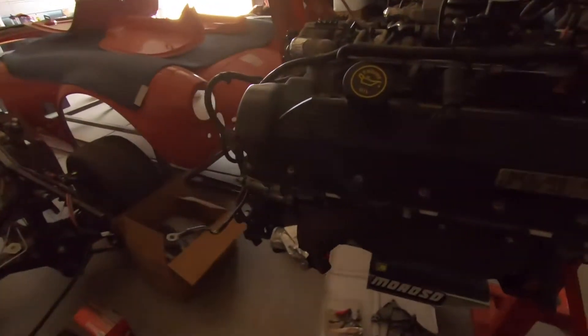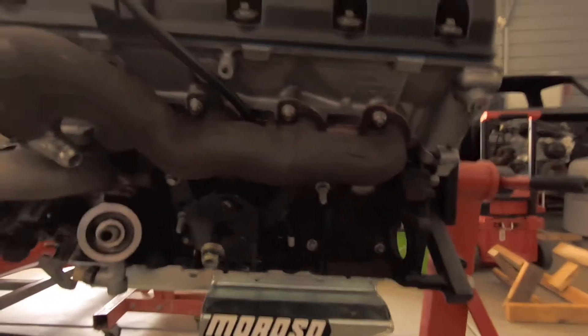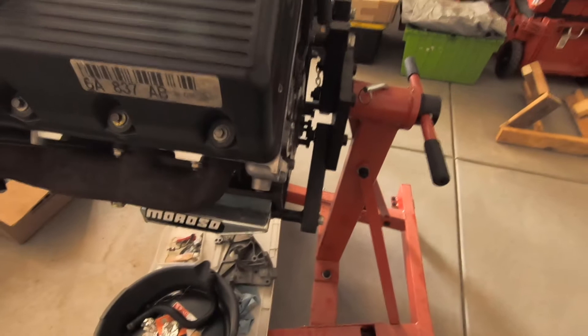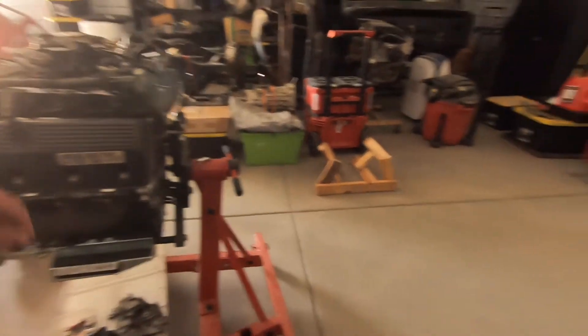The other update is I've figured out the EGR extension tube. The EGR tube originally starts at the EGR valve, goes down, connects to these tubes, comes down to about the end of the cylinder head, and then it curved over. I cut this off, made it straight, and I'm going to have the guy at the fabrication shop handle the tubing and fittings.